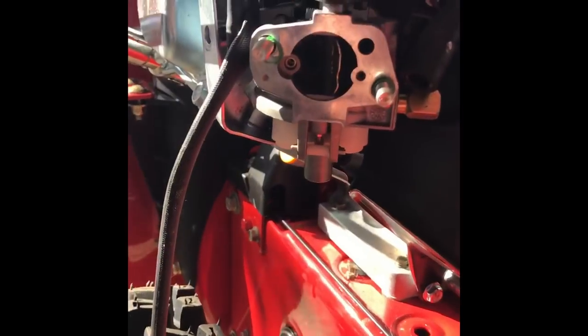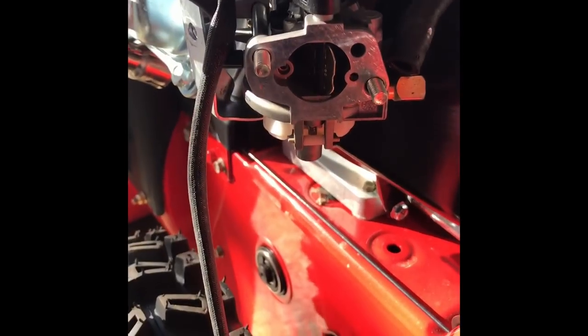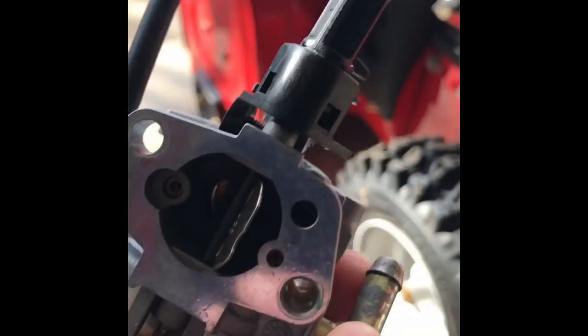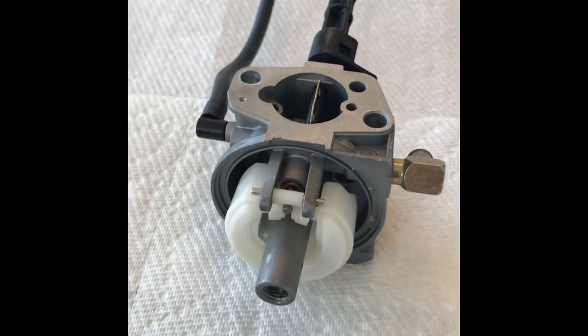You can see down here there's the carburetor, and there are two connecting wires — a thin one and a larger one. The thinner one you can just kind of pull back and up and loop it around. The other one you have to line it up and then lift it straight out. With those wires detached, the carburetor should just come free — you might have to pry it a little bit from the back of the unit, and then the whole thing slides off.